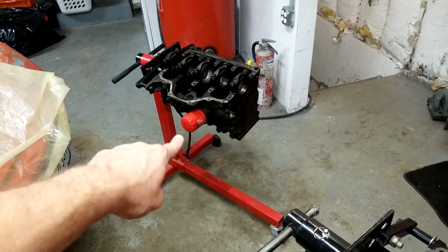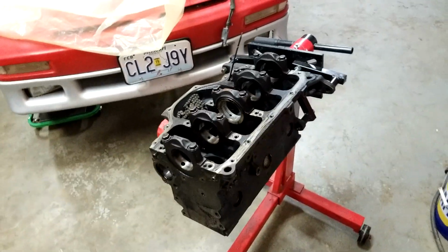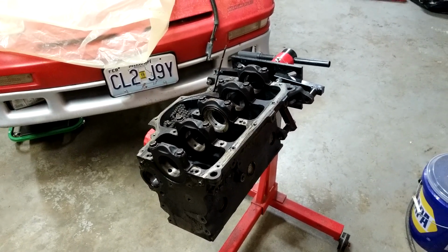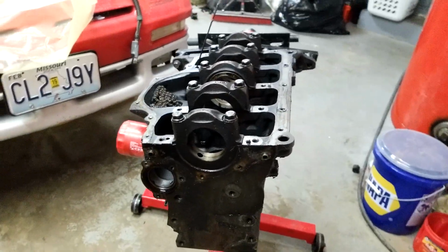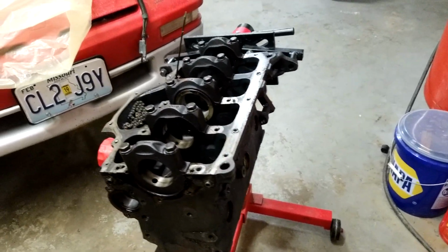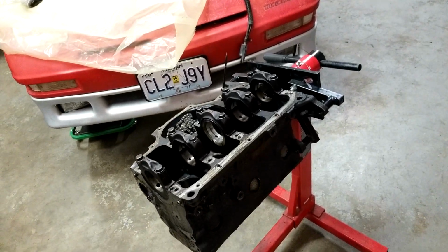It's a 2.5 naturally aspirated TBI motor, '89 common block. The only real issue I had with it was burning oil slightly. And I think that was to do with the head kind of chugging in oil through the valve guides. So I rebuilt the head myself in my backyard, underneath an oak tree on top of some 2x4s, but you know, whatever, get it done. Had good compression.